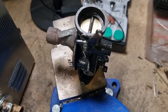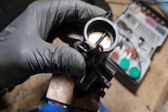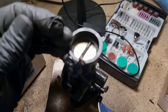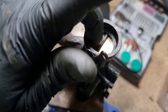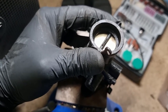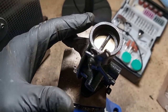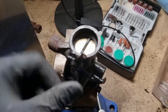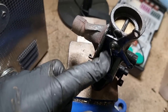Again, there's a little bit of a secret to here. What I could notice was in its resting position, those holes were slightly covered. And the only way that you could uncover the holes in the plate would be to push that in. And then the holes lined up perfectly. So in its default position, there's ever so slight lateral pressure on that staple to stop it coming out. And it's now in properly. All that remains is to just connect the spring.